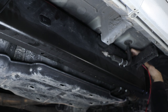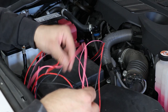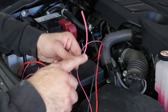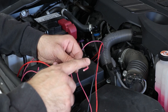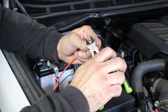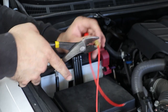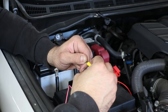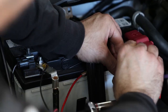Run the wiring harness up to the engine bay along the top of the frame rail, following the brake lines all the way to the engine compartment and up to the battery. Cut the red and black wires to size. There is also a pink wire — this optional wire can be connected to the ignition switch with a fuse to turn the compressor on with the ignition. We won't use it so the compressor can be activated anytime via the remote or mobile app. Connect the provided fuse to the red power cable using the heat shrink butt connector, then add terminal connectors to the red and black cables — red to positive, black to negative on the battery.